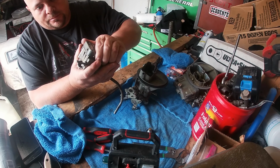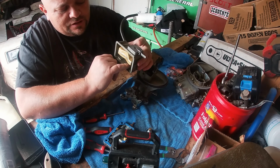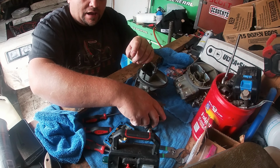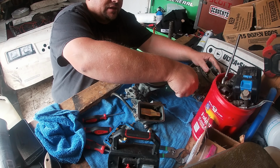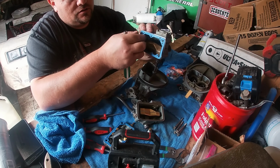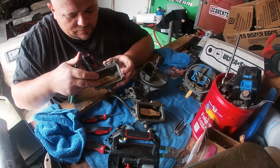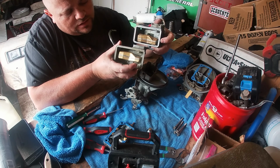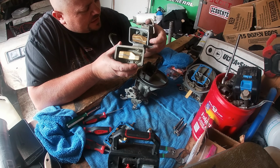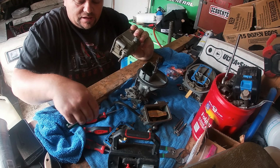If I turn this upside down, it looks like it's going a little low, but you can't determine by that. But it stops. And I could almost put my finger underneath it. Now that's where I had another problem with this other carburetor. I haven't really looked into it that far. But here, watch, I could pull it apart real quick. This is my backup. I was looking at it the other day. So if we check here, actually I could even just pull this gasket off. This one here, it's going all the way down to the bottom. And really, it doesn't look like it's actually on right, but I don't understand why it's not bottoming out like that, unless it's the needle and seat, maybe. It's the wrong one, is what I'm gonna maybe guess.